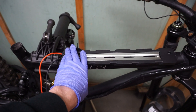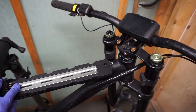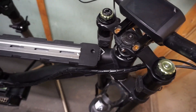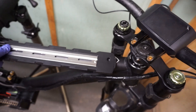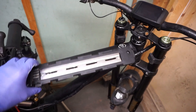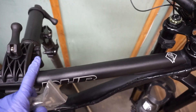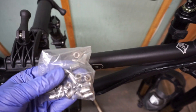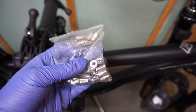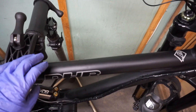I have to put the bike on the ground and remove the clamp to find the best position for this bracket, to avoid potential conflict with the fork when it's rotated. I want to avoid the fork hitting the battery. There are no holes on the frame, so in order to fasten the bracket I will use rivet nuts — stainless steel type. You can buy aluminium ones, but I recommend steel ones: much stronger, they can hold the load of the battery.